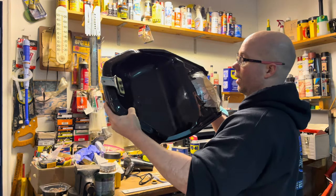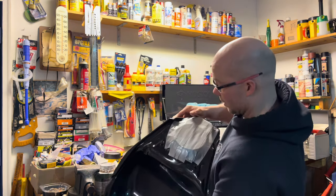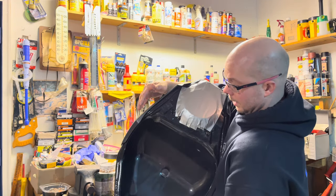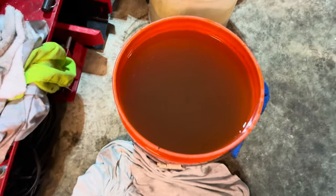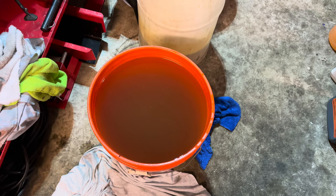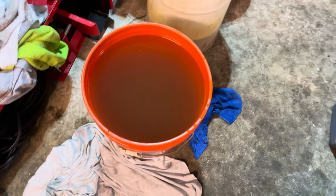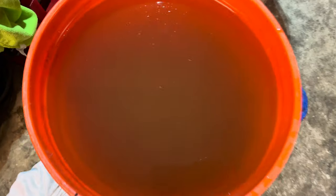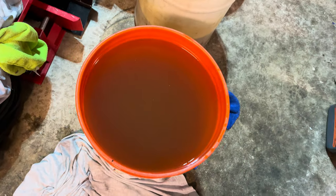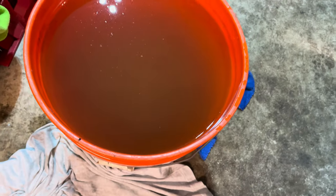It's going to seem like it takes forever, but you really want to get it on every spot. I didn't cover the fuel opening at first so I could see where the liquid was going, making sure I coated all that area before focusing on the bottom half. Here's the five gallons of vinegar — you can tell it looks pretty bad with all the rust that came out. I bought a strainer initially to catch the rust but honestly don't waste your money on it. Vinegar does a great job.